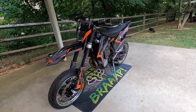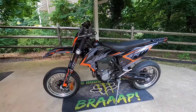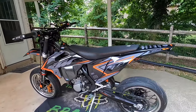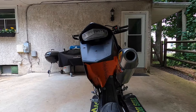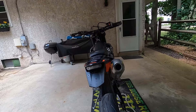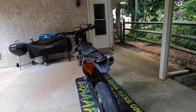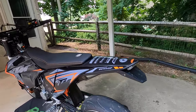I'm just filming on my little GoPro today, just FYI. I also got the rear integrated tail light with the turn signals built in from Takamoto. I had to buy the flasher relay because it's LED now - that's behind the headlight.